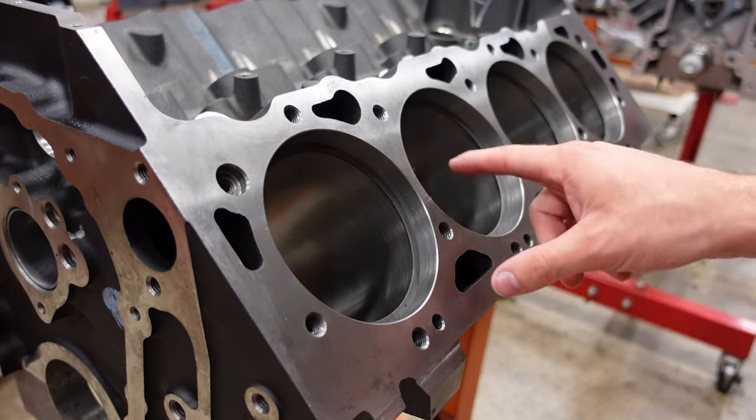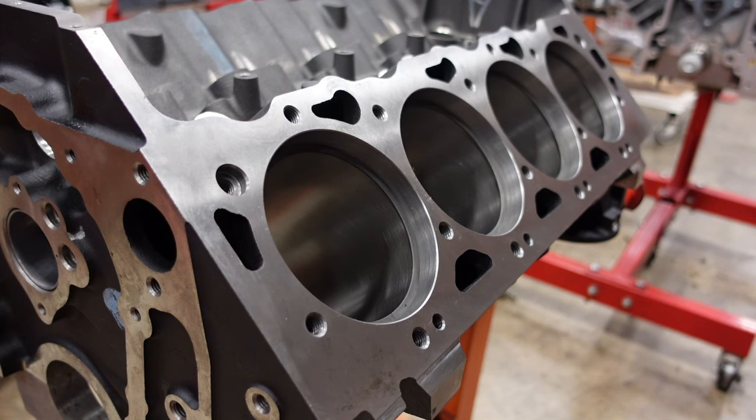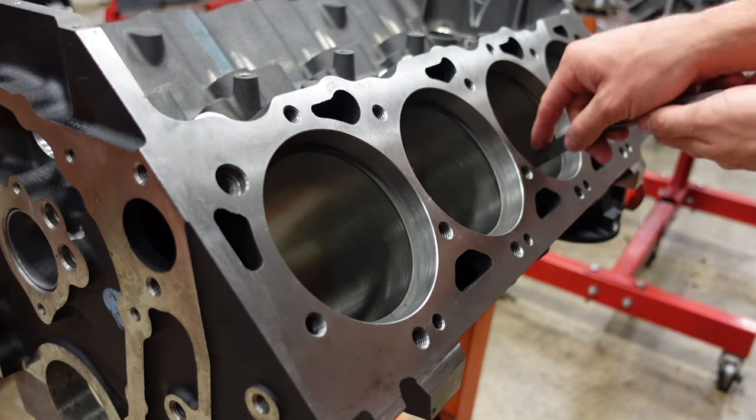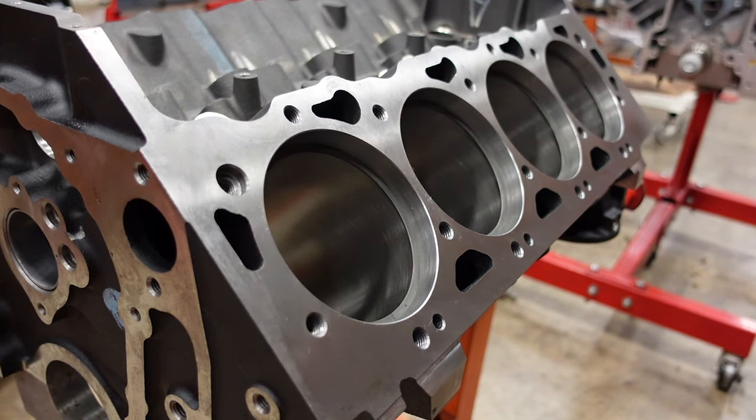At this point there should be a very small gap in all the rings. If there isn't, you'll have to take a cut first before you can measure anything. We have a little gap — looks to be about five thousandths to me. We're just going to check it with a feeler gauge. Yeah, we're about five to six thousandths gap currently. My top rings currently have a five to six thousandths gap. So if my total gap I want at the end is 25 thou, we can subtract what I currently have and we have about 19 to 20 thousandths of material to remove from the rings. Let's go to the ring filer and make our first cut.